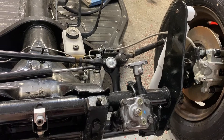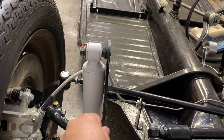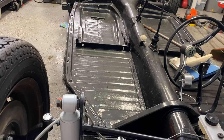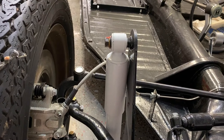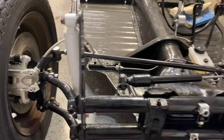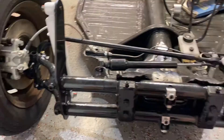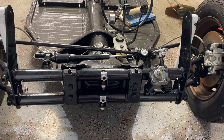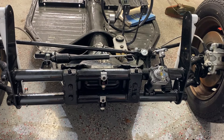There's a thinner shock tower here for the body, so the body can sit properly. Because as you shorten the beam, the beam gets shorter and you don't want the shock tower to get in the way of the body. I went with MP shorter shocks — I may go with a different type of shock. Don't go with gas shocks; they seem to be a little stiffer. For the torsion bars on the inside, I ordered from Air-Cooled. I told them what beam I was going with, and in less than a week it came and fit right in — just perfect.